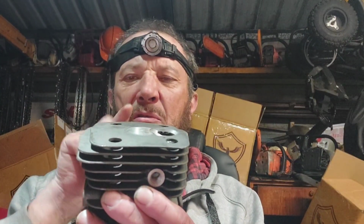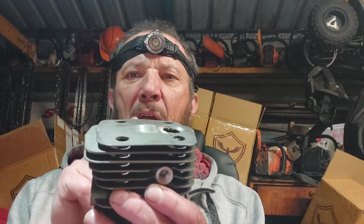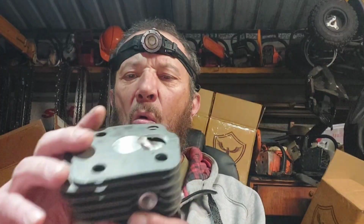So your upper transfer blows towards your cubby first, the boost port then opens up and throws it towards the exhaust, because it's pointing basically straight out the front here. Then the last part of the upper transfer shoots back against the boost port and hopefully that will work. So that's what I'm trying to do, because it makes sense to me. Physically it makes sense.